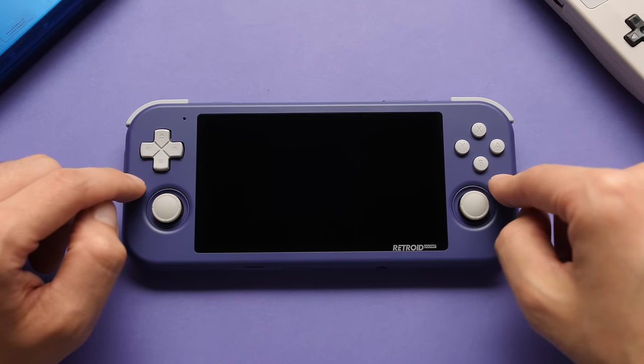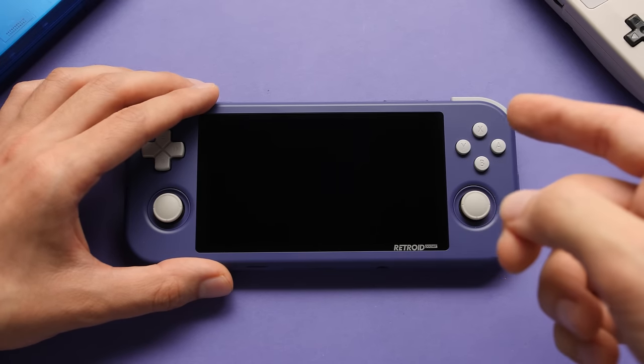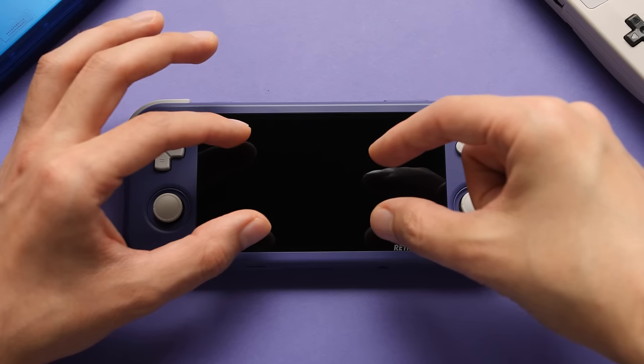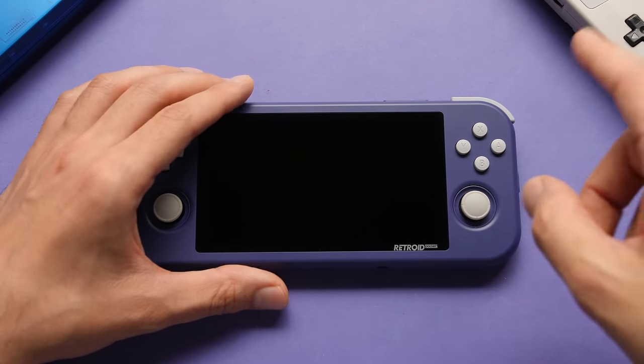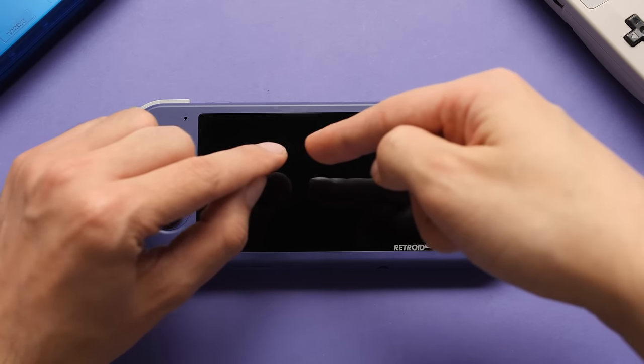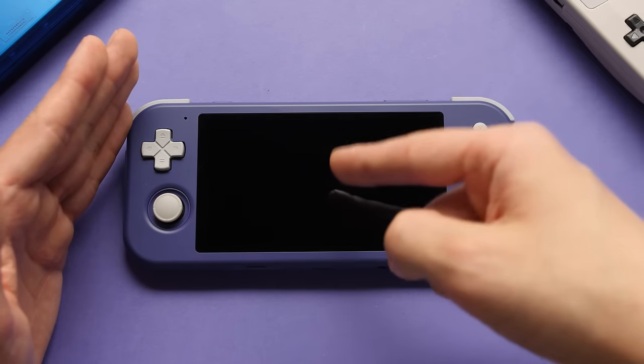If you're in a situation where you have hardware that was configured incorrectly in software, then you can usually find out if that's the case by looking at how the screen looks before Android is fully booted. The good thing for us is we have a boot screen on all of these devices that has a logo in the middle, and we can use that to judge the white balance of the screen. So what I did for the RP4 Pro was boot up the device and then look at the boot screen before the Android system is fully initialized, and I saw that that was green.